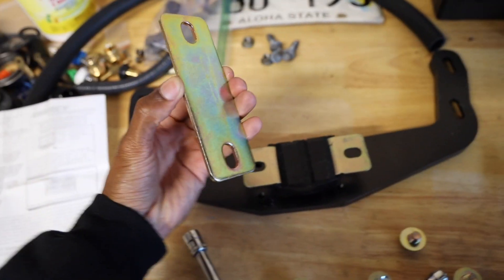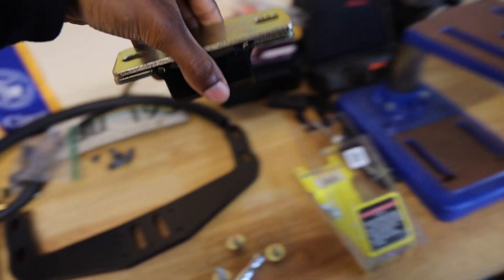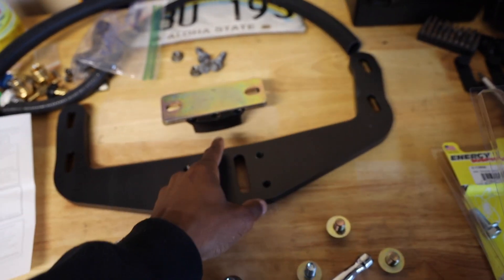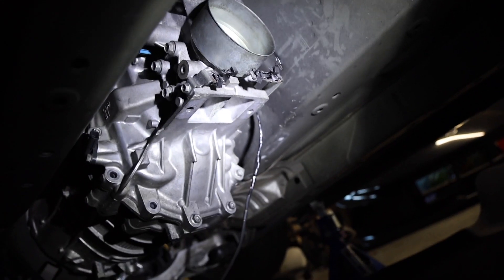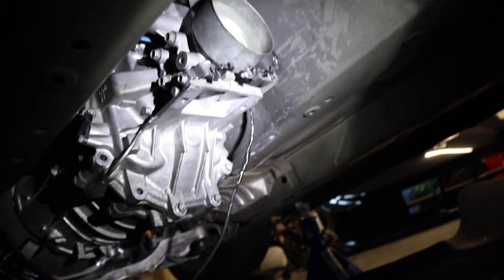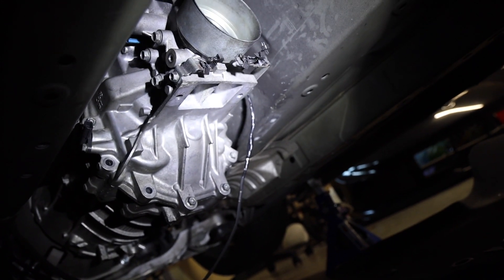My first mission is putting this little bracket here over here — we're going to mount this to the car first, and then from there mount this to that and try to get everything to line up. Coming under the car, you guys can see the two bolt holes right there. That's exactly where this mount is going to mount to. Then on the bottom of this we'll mount the actual transmission mount, and they will line up with the actual mounts on the car. Let's get started.